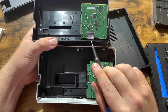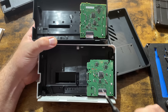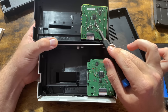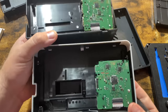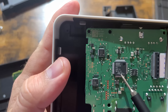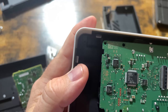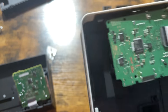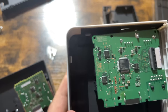On the back of the board, they did move the ribbon cable that connects the charging port on the inside over to the right a bit more, to the left. And there are more chiplets back here — we have three chiplets here, plus one, two, three, four, and then there's a little tiny one right there. This is an ARM microprocessor. This has the ability to manage the whole chip and everything happening on it, including the Ethernet. It also has memory in it that can be updated — this is where you get your firmware updates, in comparison to the original. So this is new.